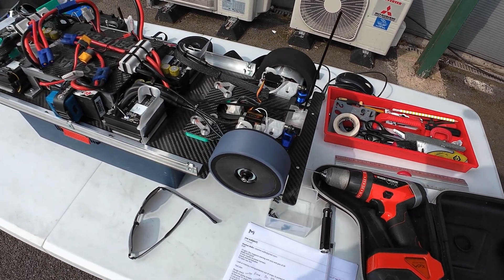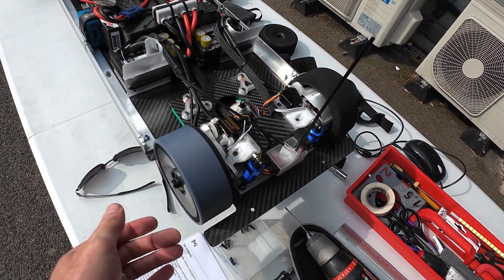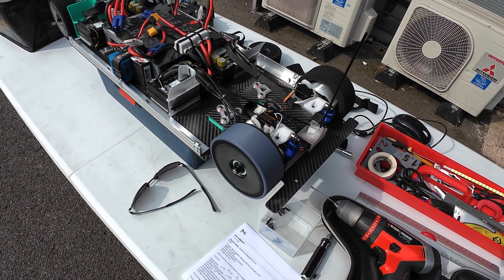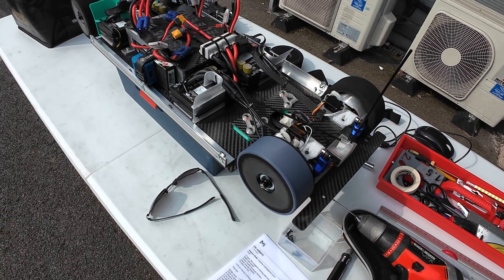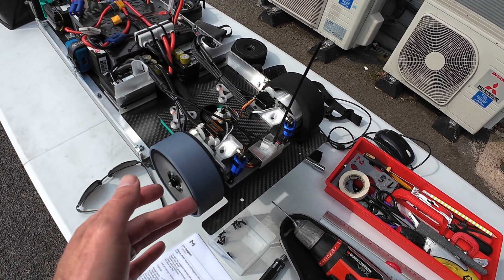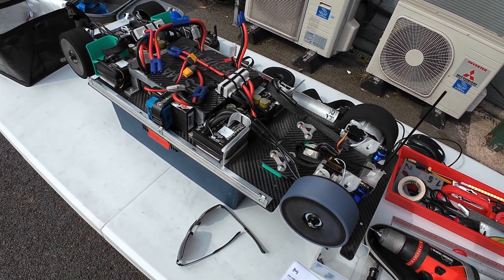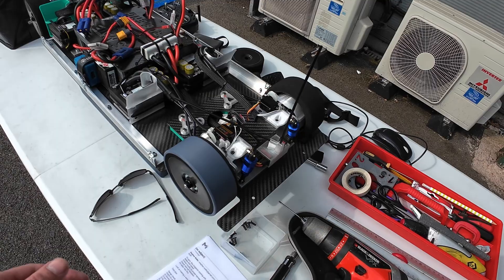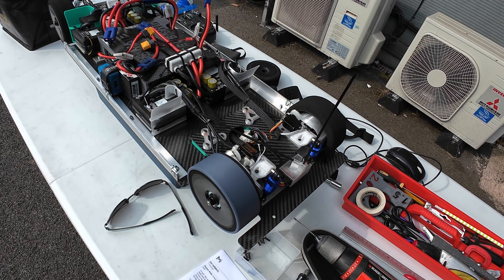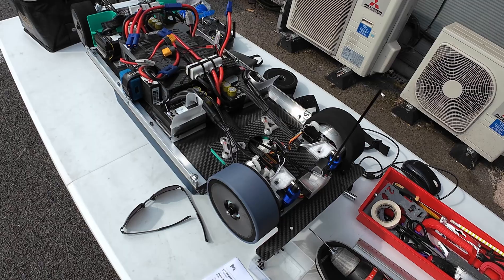I'm about to start the first actual development test, and I'm going to run the car with this drift sleeve to reduce the friction on one tyre. The idea is to assess how well the traction control algorithm works with the speed controls I'm using. First, I'm going to run it without traction control — I expect this wheel will spin up to quite a high speed almost instantly. Then I'll run it with traction control on, and it should limit the spin-up of that wheel. I'm going to try those things next, then choose the best setting to go forward with for all the other testing.